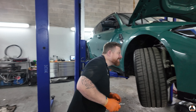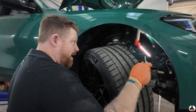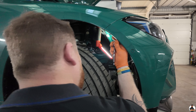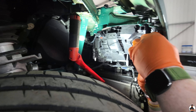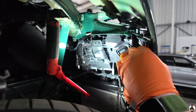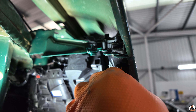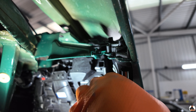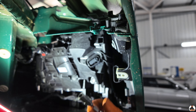Step five — the 8mm screws that go up into the bumper. We're going to undo them now. The two 8mms are pretty long screws. Sometimes you can get in with a little buzz gun if you need to.